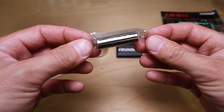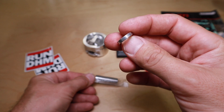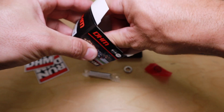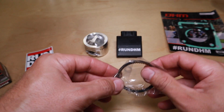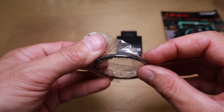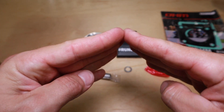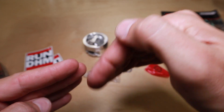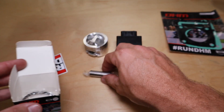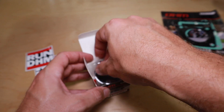The wrist pin looks like Honda OEM packaged stuff. And there's that mystery spacer again — what is that, where does it go? Probably an easy-to-understand thing I just can't think of right now. You also have your piston rings here — piston rings are very important. I'm not going to open these up because I don't want to lose them. But each piston ring typically has an edge, a bevel. Some piston rings have two edges. You want to make sure you get those piston rings on the piston the proper way or else you won't get that compression and things will not work right.